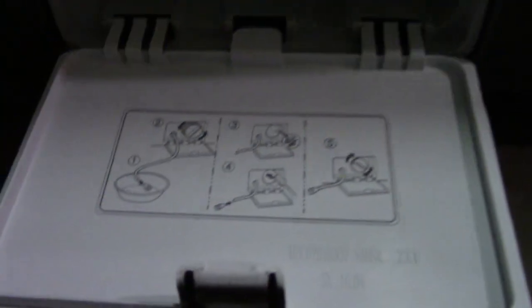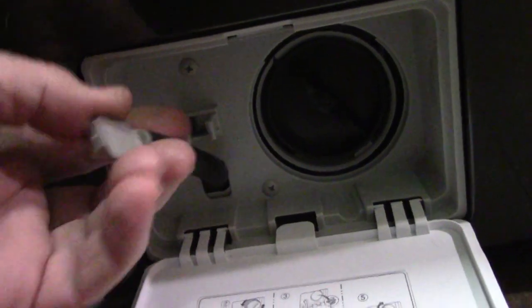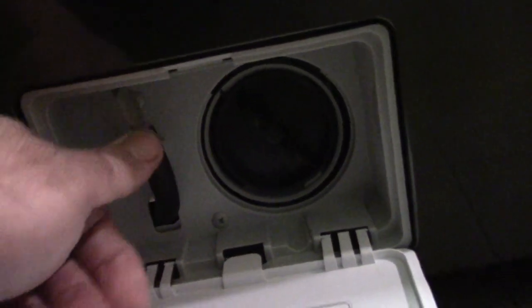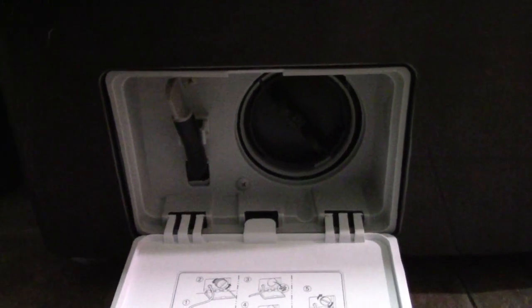One more thing to show: on the bottom left side there's a small access door — a clean-out. There's a little hose you can pull out, remove the end cap from, and drain excess water. There's also a coin trap filter you can remove and clean. You're supposed to do this about once a month. My wife hasn't done it yet, but it's a handy feature to know about.